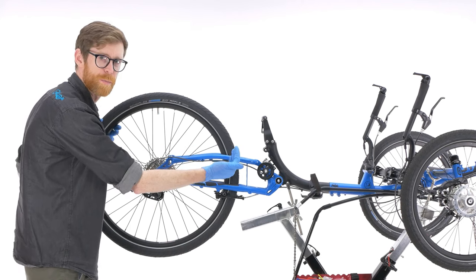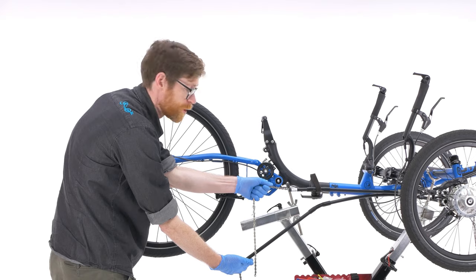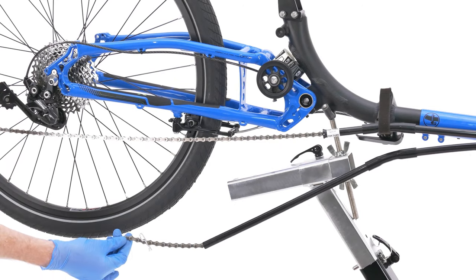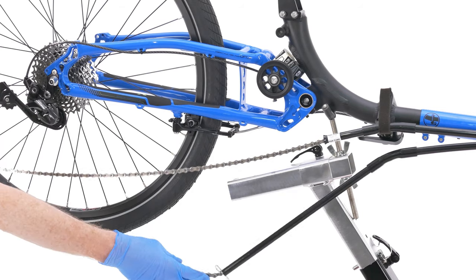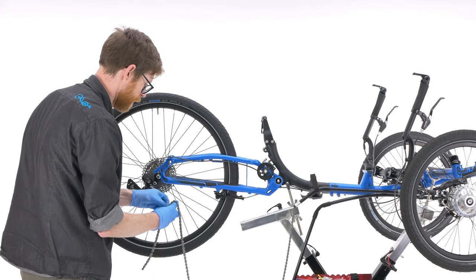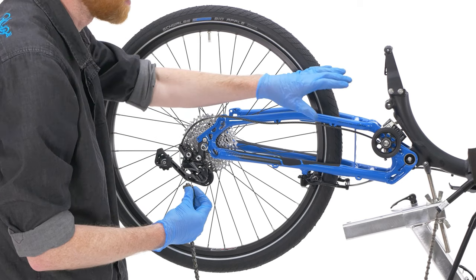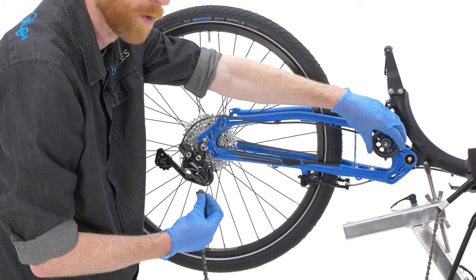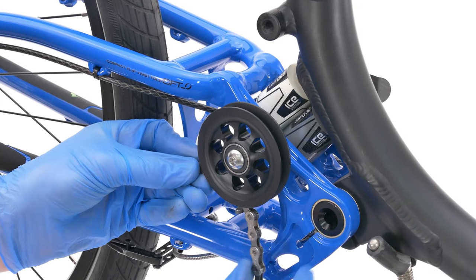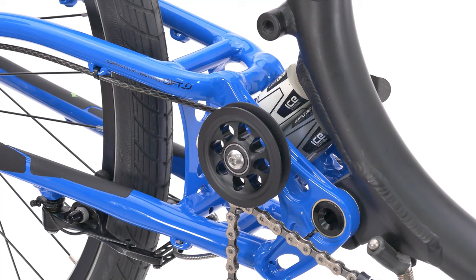Now that the chain is linked at the front, pull the length of chain through to the back — take the chain coming out of the top tube and pull it all the way through until it starts to pull the bottom tube through to the R pin, giving you all the excess chain to work with getting through the rear derailleur. Remove the R pin. On this 26 RS trike there's a second pulley on the back end, so feed the top chain between the metal retention tab on the bottom and the pulley itself, then pull it all the way through.